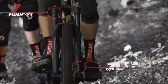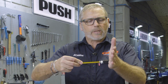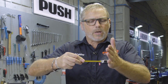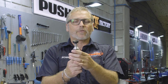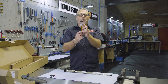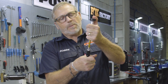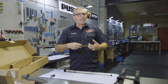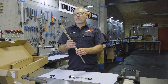The most important part is the damper and the coil pair. If you look inside here, there's an actual coil spring — as I compress it, this coil spring gives about a centimeter of free play in the fork. Combined with your positive and negative air chambers, there's a dimple inside the air side that allows air to escape across into the negative chamber. On top of that, for your first couple of centimeters of travel, you get a very nice coil feel.